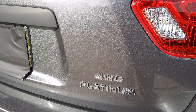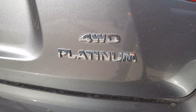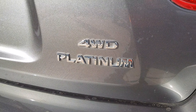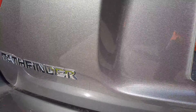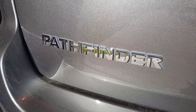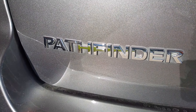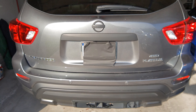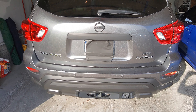For the first step, make sure that you've thoroughly cleaned the emblems that you are going to be covering in PlastiDip. I've cleaned this one off with just a solution of isopropyl alcohol and water — 70-30% — and then dried it off really well. I have this facing in the sun to help warm up the substrate or the surface, and when I spray it, it'll help it dry faster. Very important: make sure the items you're going to be covering are very well cleaned.